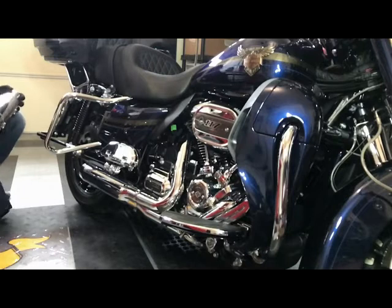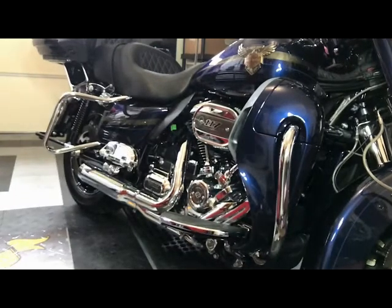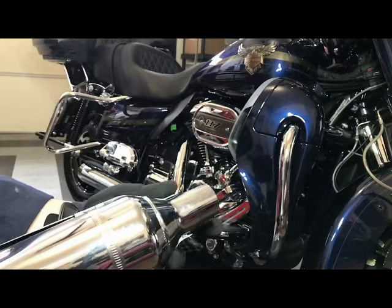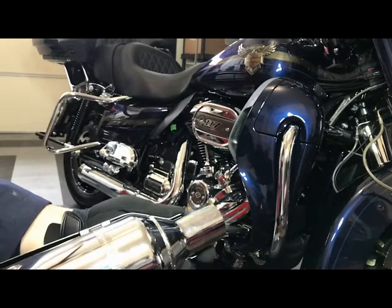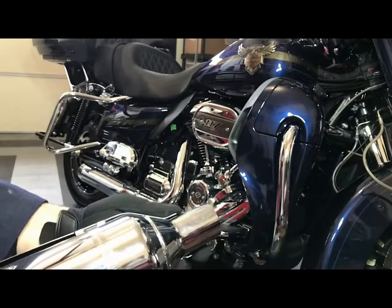They come off. Now I'll move to the other side. Just as a reminder, the left side of the bike is a smaller diameter inlet on the muffler, and the clamp is smaller, only requires a 9/16 socket instead of 5/8. So far, 3 tools and both cans are off.